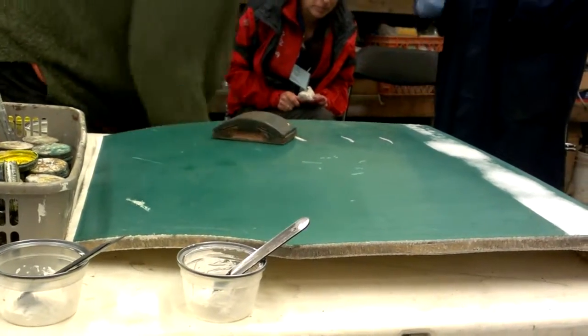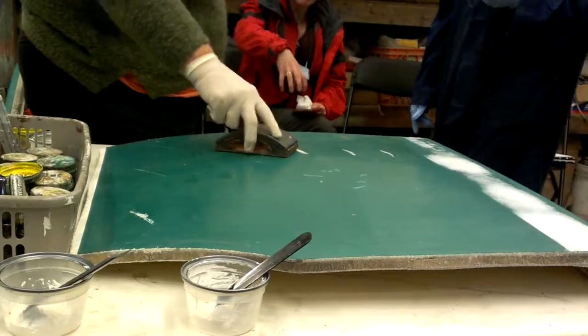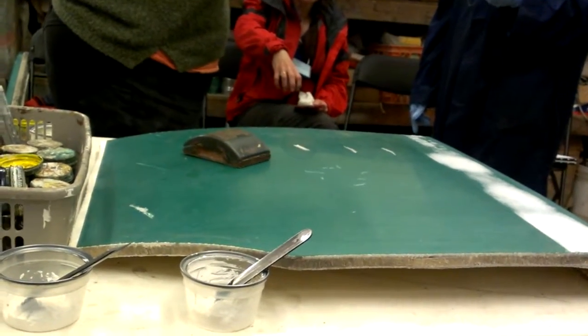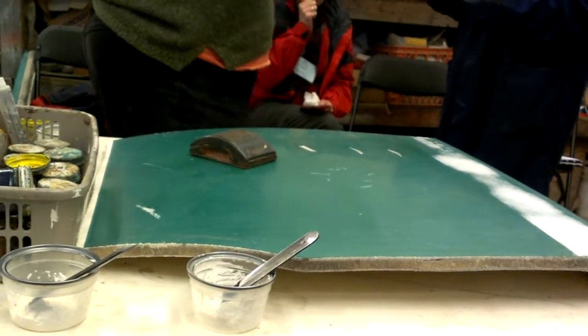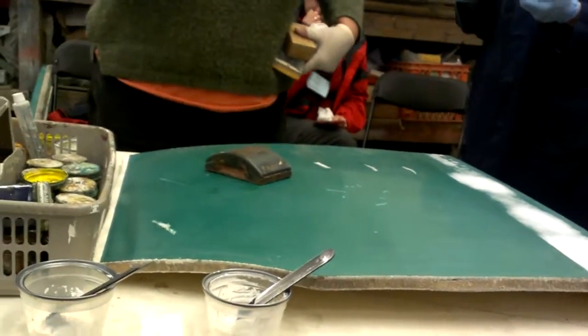At what point? When this is still drying. So this is before you sand. We've mixed our thickener, we've made our color, we've matched that up, and we add our catalyst, which will be the next step here. Then you smear this in.